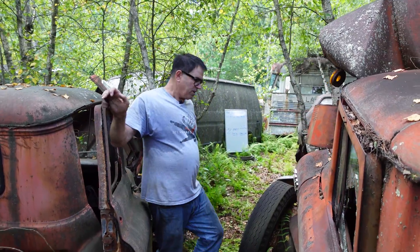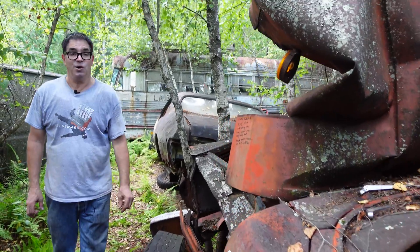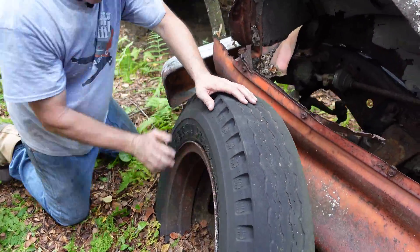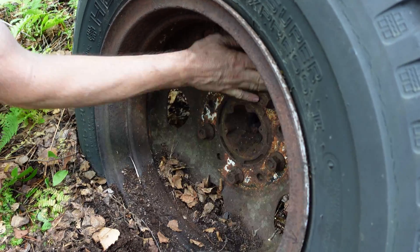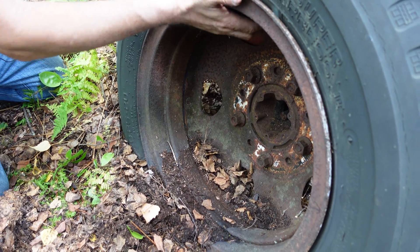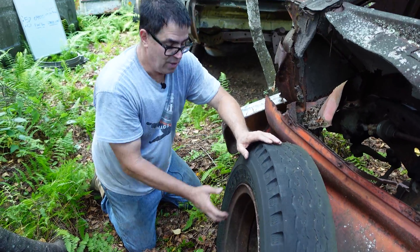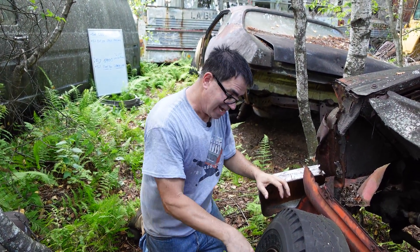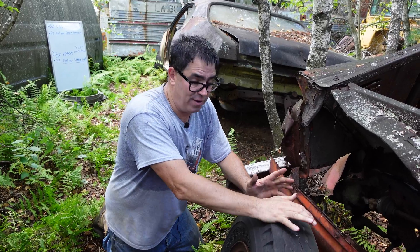Getting back to this truck, something we see that's kind of notorious are what we call the RH5 style Widowmaker wheels — split rim wheels. Whenever you see a wheel like this and inside the middle part you see a raised area, that tells you you're dealing with a two-piece rim. These are okay — Firestone, Bud, and Kelsey Hayes all made wheels like this — but these were outlawed in 1974. The trouble with these is that in order to mount the tire you have to get things just right. There's like an eighth of an inch flange that must be just right, and with the tire installed you can't tell if you got it right or not.